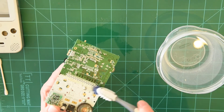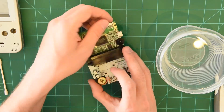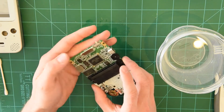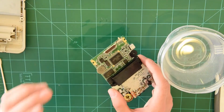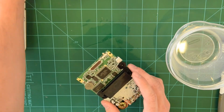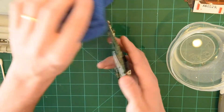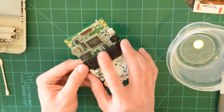That's a really good way to help if your buttons aren't working well too — rub some alcohol in there. But we're just trying to get this to work. So without any vinegar or work on the corrosion, we're going to see if that was the issue. Keep in mind there might be more wrong with this, but in general I'd say probably 70% of the time what's wrong with your Game Boy is just this little power switch. In order to test it without completely rebuilding it, I'm just going to wipe it off a little bit — I kind of went a little trigger happy with that isopropyl alcohol.